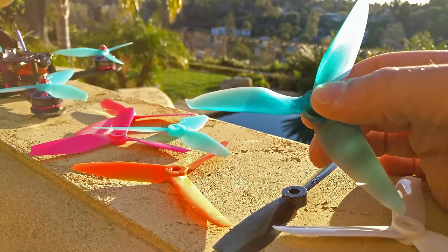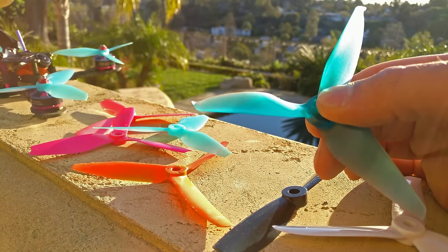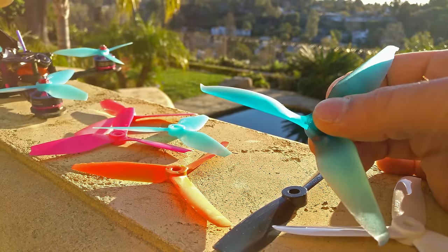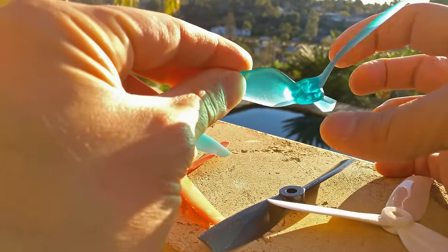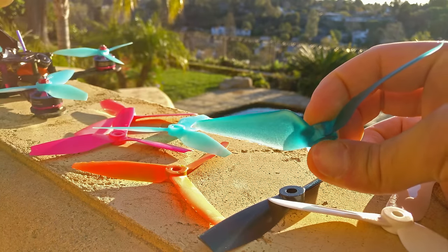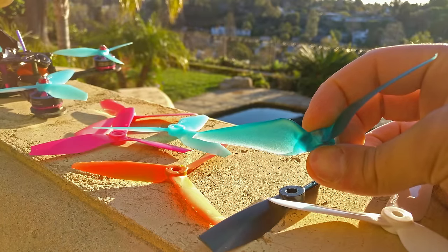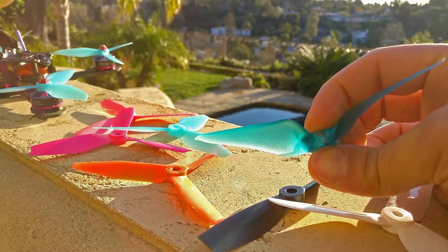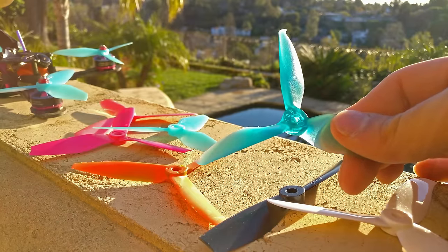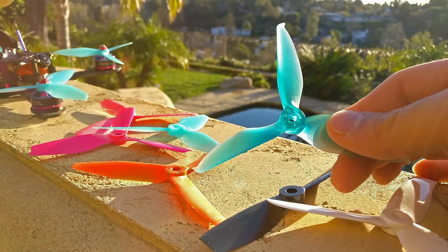As you surpass that engineered speed, the prop ends will begin to create more drag because they're beyond the speed they were intended to fly at, and the middle scoop will take over. It'll take over because it's big and meaty — now spinning at the higher RPM needed to create thrust. So the ends are creating tons of drag, and the middle of the prop is creating tons of power and grunt. That's how I guess the speed and how it will perform on the throttle. This prop has a very linear throttle, doesn't do much at low RPM, is really geared for one good speed, and above that it's just crazy fast — below that you lose a little control.